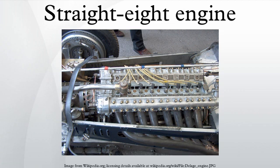After World War II, changes in the automobile market resulted in the decline and final extinction of the straight-eight as an automobile engine. The primary users of the straight-eight were American luxury and premium cars carried over from before the war. During World War II, improvements in refinery technology used to produce aviation gasoline resulted in the availability of large amounts of inexpensive high-octane gasoline. Engines could be designed with higher compression ratios to take advantage of high-octane gasoline, leading to more highly stressed engines which amplified the limitations of the long crankshaft and camshaft in straight-eight engines.